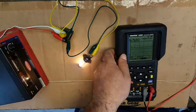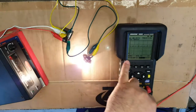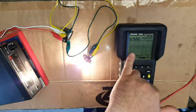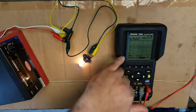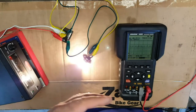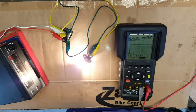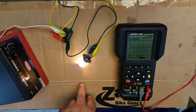And on the screen, on the actual oscilloscope, we've got now essentially a digital wave. We've got a voltage supply, which is the peaks at the top, and then we've got 0 volts down the bottom. And it's basically the bulb is either on or off. There's no in between. It's not like the linear scale was before, where it would slowly increase and slowly decrease.